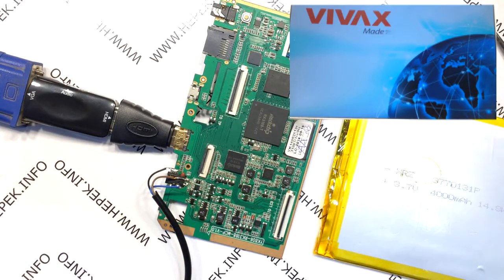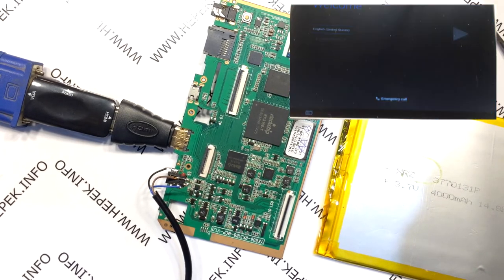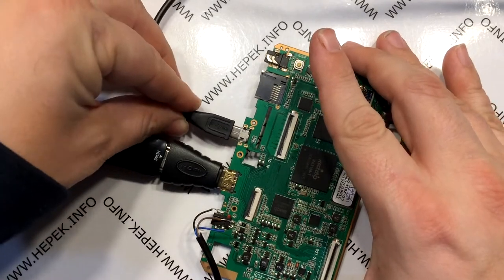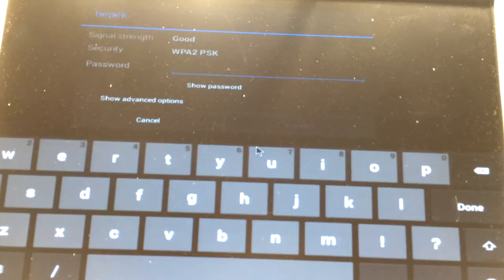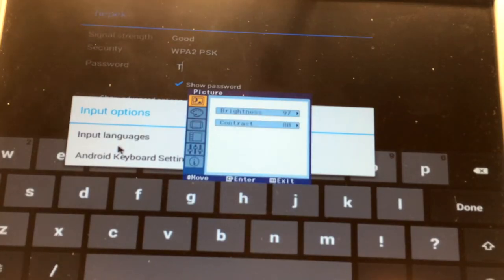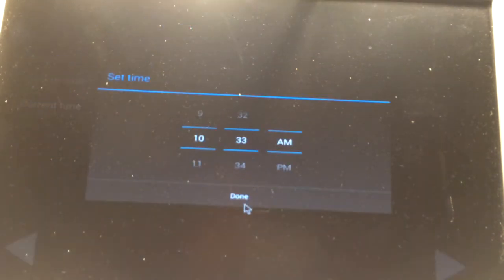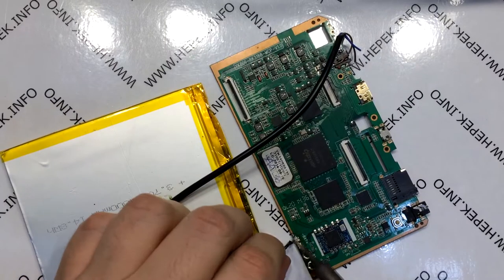Now that I have turned on the device with the battery, and after installing the new firmware, it is necessary to do the initial setup of the device. I connect the OTG cable — just a micro USB to USB adapter — to connect a USB mouse and set the initial configuration. It even has WiFi signal despite the antenna not being connected, but without an antenna it could not establish a stable WiFi connection to do the authentication, so I'll skip the WiFi setup for now. I set the date and time, and we go into a graceful shutdown.